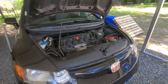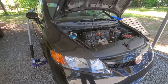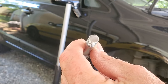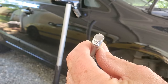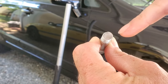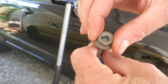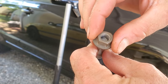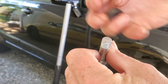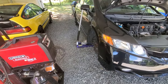You're going to need a welder and I have my Lincoln MIG welder set up ready to go. Make sure you disconnect your battery terminal on the car when you're welding, because you don't want to take any risk of damaging any of the electronic components. Since it's pretty tight and hard to get a camera into the area, I'm going to show you using the other piece of the bolt — just imagine this is countersunk about two millimeters. You're going to build this up with weld just enough to where you can take a nut and slide it over top. Then you're going to weld it up solid around the top, making it one piece, and you can turn the nut and it'll extract your broken bolt. Easy as that. Now the only thing left to do is fire up the welder and get that broken bolt extracted.